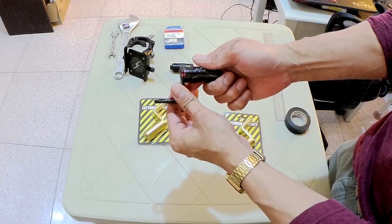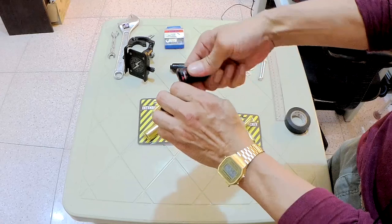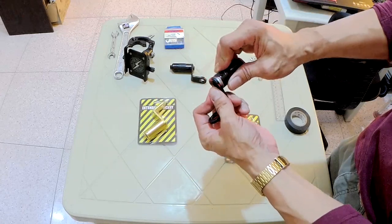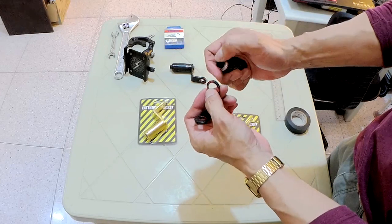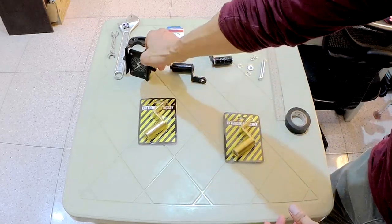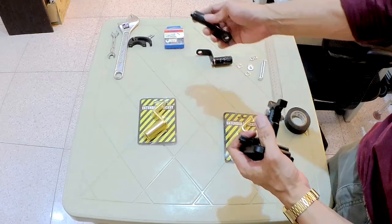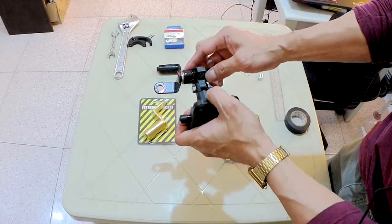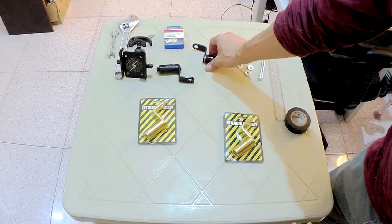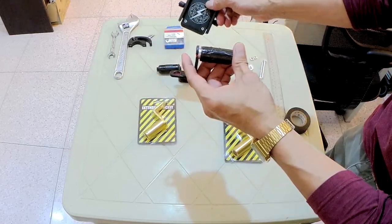After long rides, it gives out — it comes loose, just like that. It loosened up. So, it's only crimped — the aluminum is just crimped onto this part. The mouth of the bracket is only crimped on. That's why it rotates. The cell phone holder is also slippery, which is why I added electric tape and stickers to make it grip. The bracket gave way because the cellphone holder is much heavier than the bracket itself.